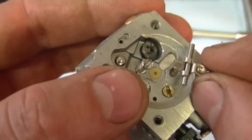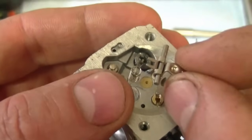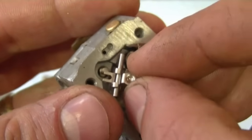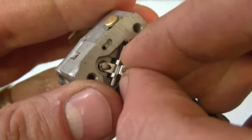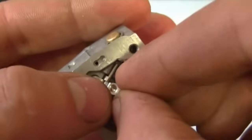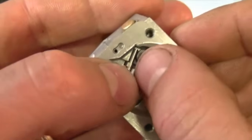Another way to install this lever and pin: you can put the needle inside the hole, leave the spring, go down with the lever and the pin. Make sure the spring goes underneath the embossed part, and just grab the needle like this and push down. This may be an easier way for some of you.